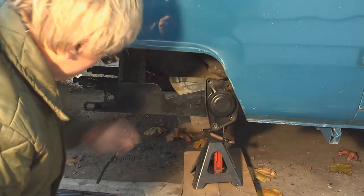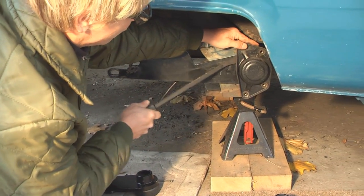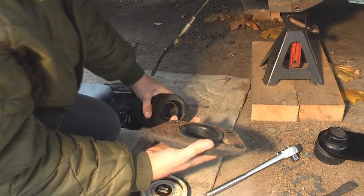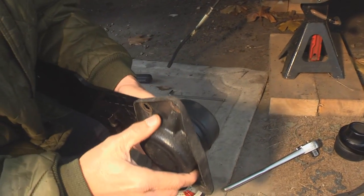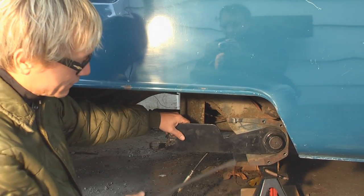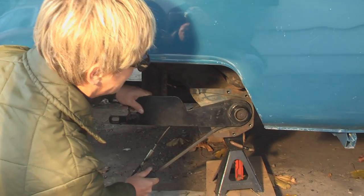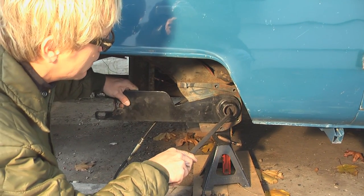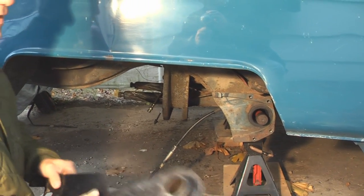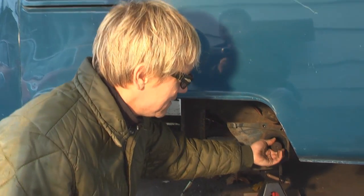Let's see what it looks like under there. I grabbed a hooked screwdriver — you don't have to have one of these, you can use a flat screwdriver, but you can see that just pops right off. There's a little rubber bushing in there that's going to fit back over there. Now we're going to pry the spring plate off the splines. Just get in behind there and pop it off — you can see how it's just coming right off that torsion bar. Because this has been done recently it doesn't come apart with any real difficulty. I've had to wrestle some of these — used heat, had to do a lot of different stuff. Don't think it's always this easy. That torsion bar actually looks like a fairly good one.